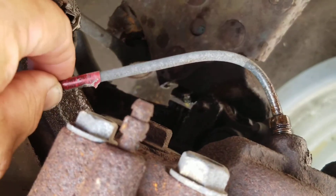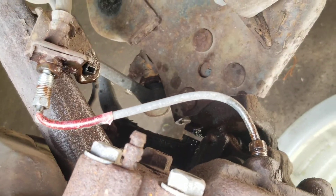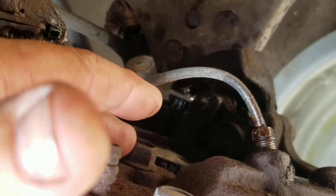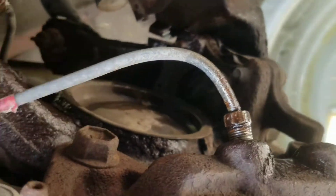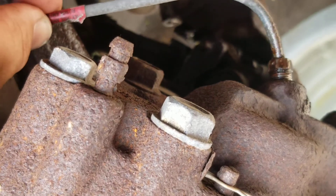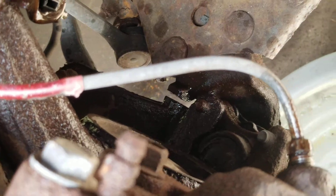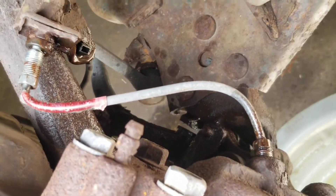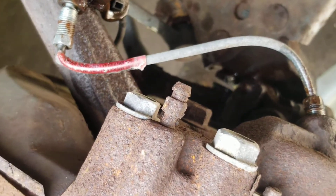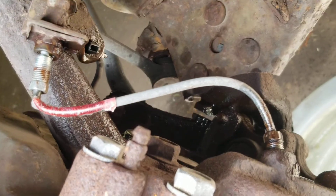What you end up having to do is take both ends of this off. Both ends are off and it's loose, but it's actually spring-loaded and stuck in position. You'll remove the caliper by taking out the two caliper bolts, get the caliper off, put the new caliper on there, and place the line back in spring-loaded. You'll have to re-spring it to put it in there, or you can replace it. No matter what you do, it's a tricky deal. I don't know why Toyota did this.